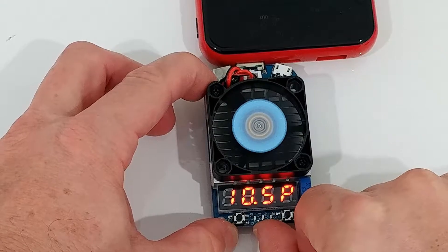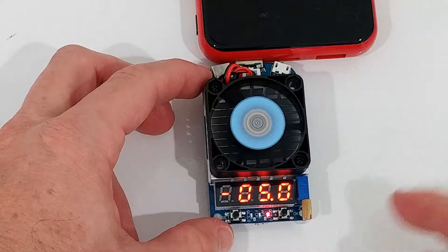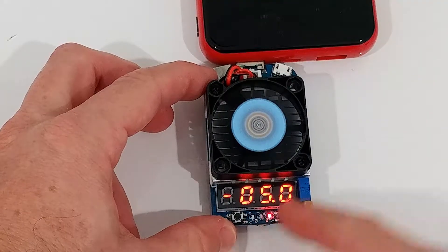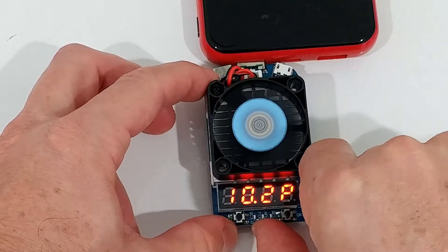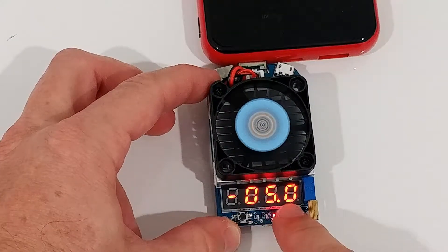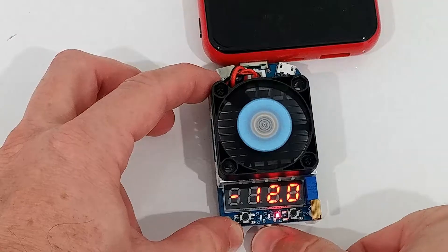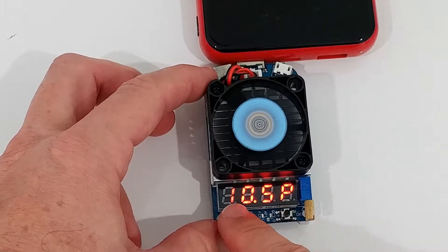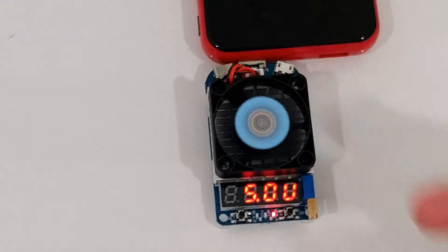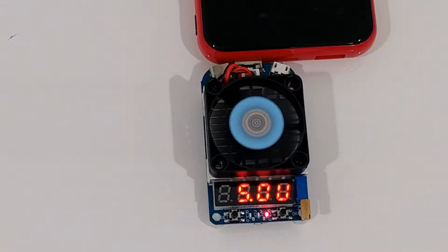We can double-check by manually searching. We press two seconds again — we're back in the special mode. We can also change the voltage here. I'll go into the settings and press until it changes the volts. Let's try 12 volts and press for another two seconds, then go back and check the volts — but it's still on 5 volts. That makes it clear it was not possible to change into quick charge, so this power bank doesn't provide any quick charge at all.